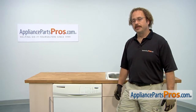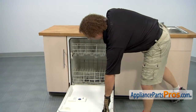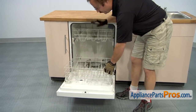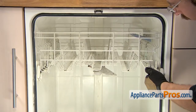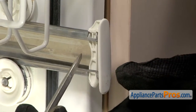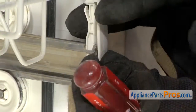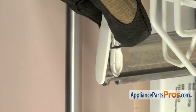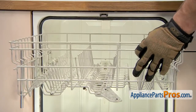In order to get to the part, we're going to open up the dishwasher door and remove both the racks. To pull the lower one out, we're just going to pull it out and set it aside. To get the upper rack out, we're going to pull these rails out a little bit and then on the back side of these end caps, there's a little release tab. The one on the other side comes out the exact same way. Now that we have the end caps off, we can pull the upper rack out and set it aside.